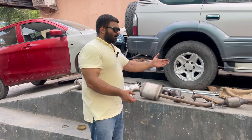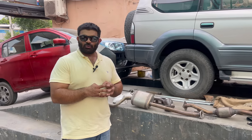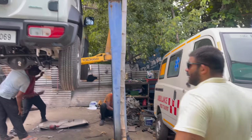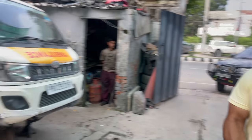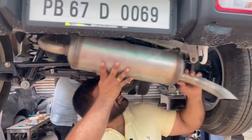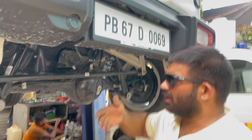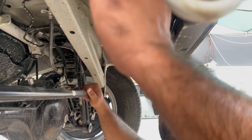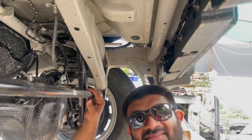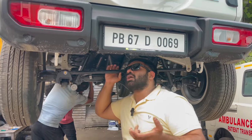So all of that science — but what is happening is we are taking all of it off. All of that is coming off and we've gotten ourselves a four-into-one exhaust. Another thing I wanted to show you: on the Jimny the first problem we faced was that the rear exhaust muffler is placed in such a way that it actually sits here at the end of the ladder frame, leaving no provision to make a neat section for a towing bar. So with that muffler gone, this entire space is now nice and empty and we can do a concealed towing bar setup that will pop out here, with the number plate going inside the tire just like a regular Jeep or those other setups.